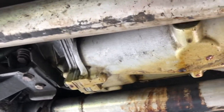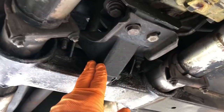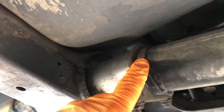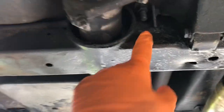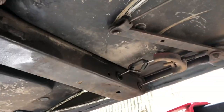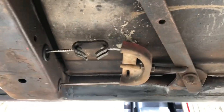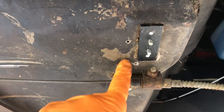Tons of leaking here — got to get a new seal there. The carrier looks to be in good shape. This is where the exhaust — I can get some fumes coming out of here. It's not welded like that one. Lots of grease buildup here, and that's from the transmission. Parking brake assembly is not as bad as I thought it would be. This is the bracket for the gas pedal — I replaced that. Someone just put screws right through the floor. I'll do some fiberglass work there, some cracking there.